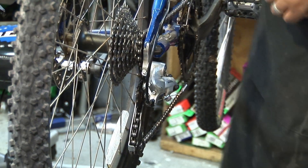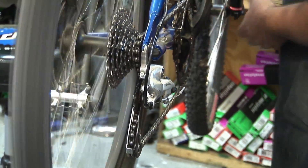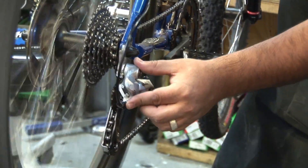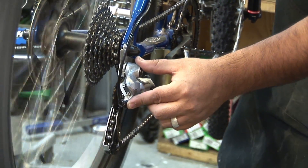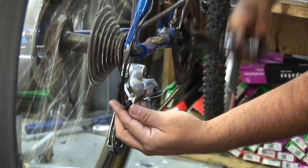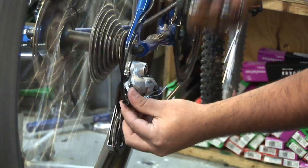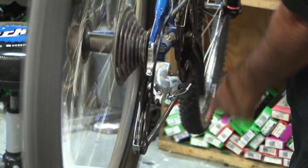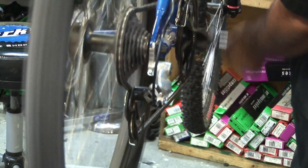Now we're starting at the natural position we need. I'm going to pedal and go through all the gears up to my lower limit. I'll be using barrel adjustment to fine-tune the rear derailleur, as covered earlier. Going up one gear — if it hasn't shifted, I turn the barrel adjuster in until that gear moves up nice and clean. Then I back down and run through the gears again to make sure everything is shifting right.